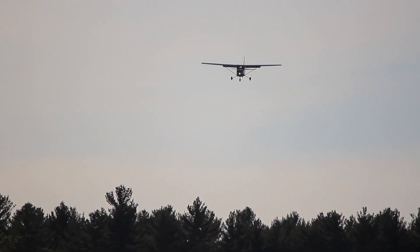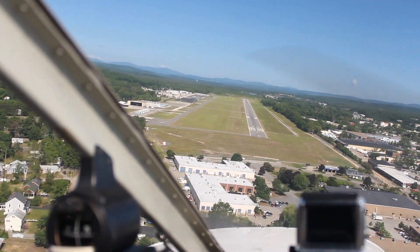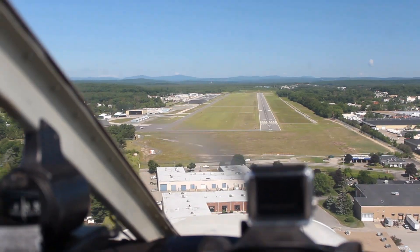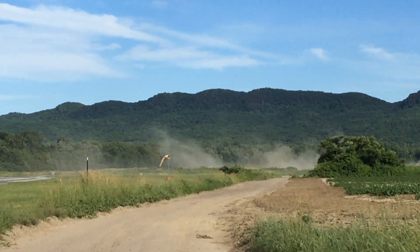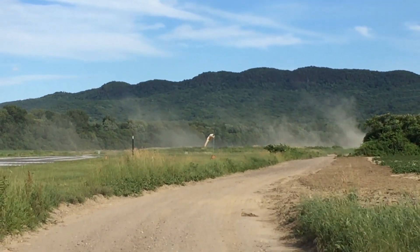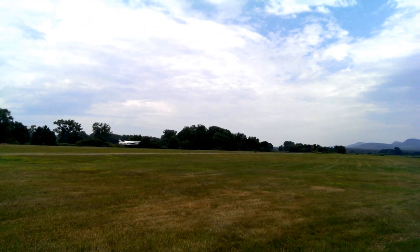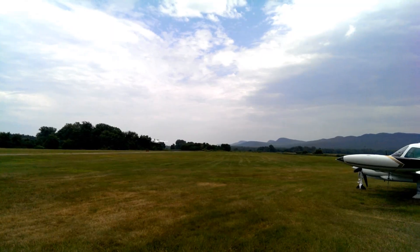But you could actually be putting yourself in more danger this way. Did you notice that when carburetor heat is engaged, the air entering the engine does not pass through any filter? It comes from around the exhaust, an area often prone to rust, debris, and other contaminants, not to mention what's already up in the air. There's a reason that all engines have air filters. Airports are often positioned near industrial complexes or farms where air is constantly polluted, sometimes by thick clouds of dust right over the threshold. Exposing your engine to these contaminants will shorten the life of your engine while increasing the chance of a sudden catastrophic failure.